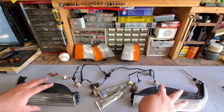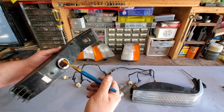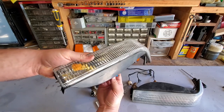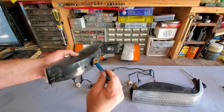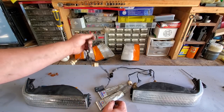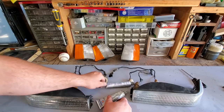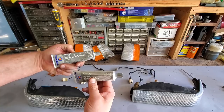We're going to use the 97-98 lenses — they're in pretty good shape. I'm just going to use my kid's paint brush and try to dust out the inside of these, make them look a little bit better. I'm going to put in a little bulb grease on these before I install them. Make sure you grab the dielectric grease, not the gasket maker — that would have been a big mistake.